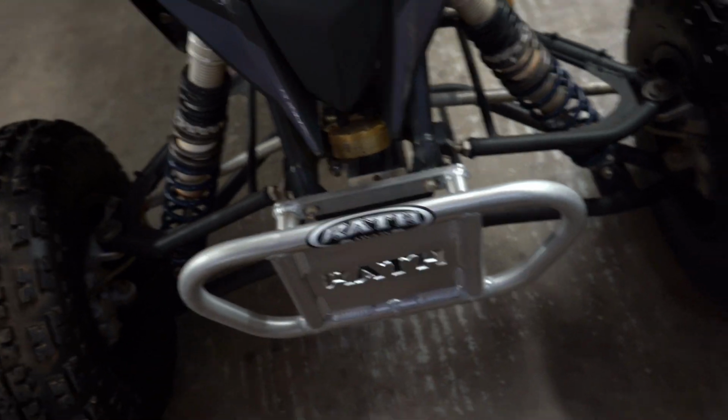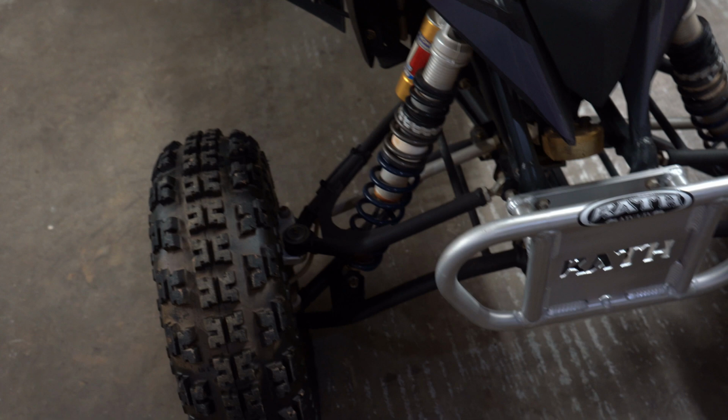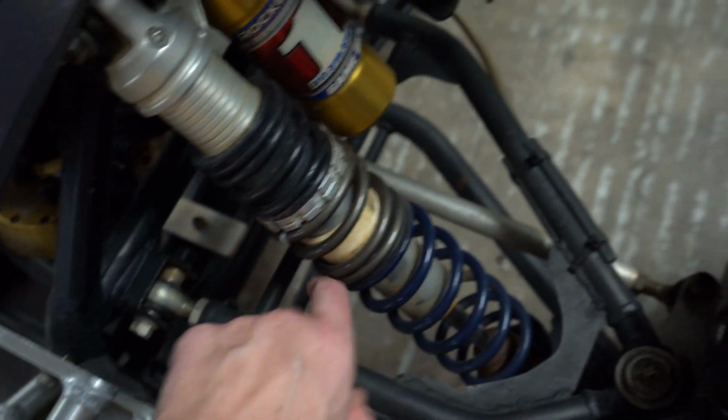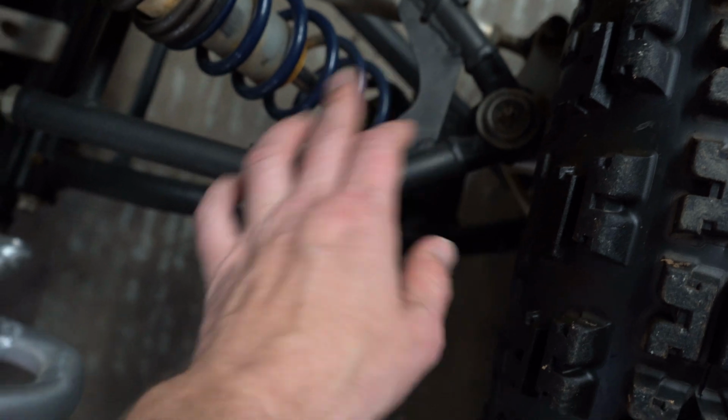It has these front bolted mounts versus everything else, which kind of bolts to the side, like the YFZ and all. Long travel shocks from the factory, freaking killer. Mike Britz actually did all this just to reinforce the A-arms. All these are gussets that he custom made or bought from somebody. Had it all welded in. They don't come with Zerk fittings on the ball joints.